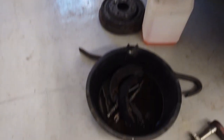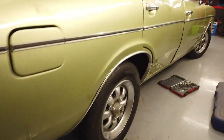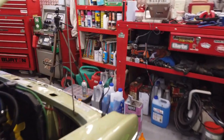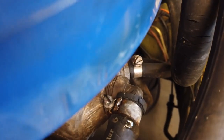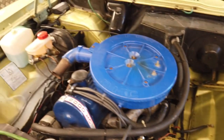So we're going to get these brakes cleaned, refurbished and fitted. Check the pads at the front, clean down a little bit. I'll show you what has happened in storage. Which reminds me, the fuel lines all want swapping, they'll have cracked. But look at what has gone in storage, and these were new hoses, although again, late 90s, but look at that weeping there, that hose. It's not original Ford hose, but it just goes to show, when you leave them stood, pipes start to break down.